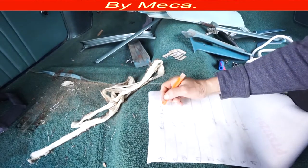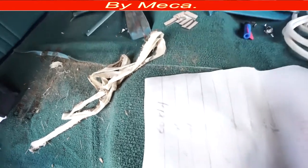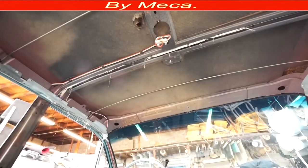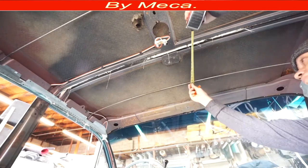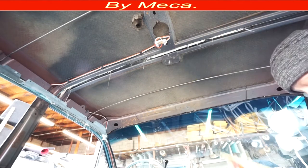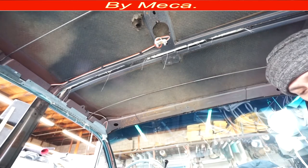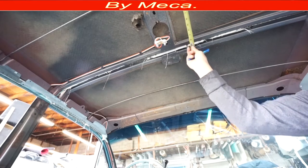I got the front piece — it's 16 by 14. You're going to measure them one by one. If you have a measurement of, say, 12 inches, give it 13 — because you're going to take a half inch on one side and a half inch on the other side when you're sewing them together. So give a half inch extra for the seams, and do the same with all the pieces. This one is 12 — you have to give it 13. That's one example.